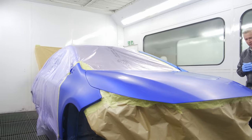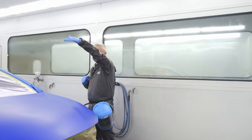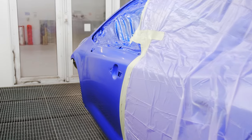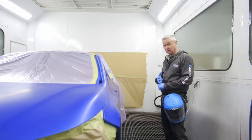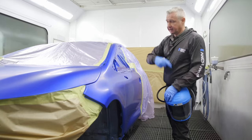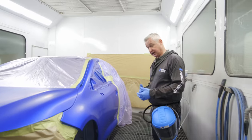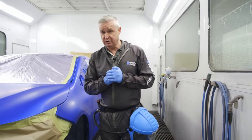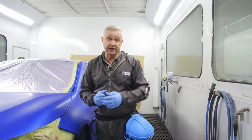On this car we're going to be painting Velocity Blue, which is a Jaguar Land Rover colour. We're going to paint a wing across this bonnet, this wing, and we're going to do a blending into this door. We'll be using a WS400 compliant for putting the blending clear on. We'll do the blend across the hood down to the wing and also using the clear coat gun as well. First we're going to explain the new OBS, explain the differences between the old and new, do some spray outs on the wall, and show you the differences and the improvements.